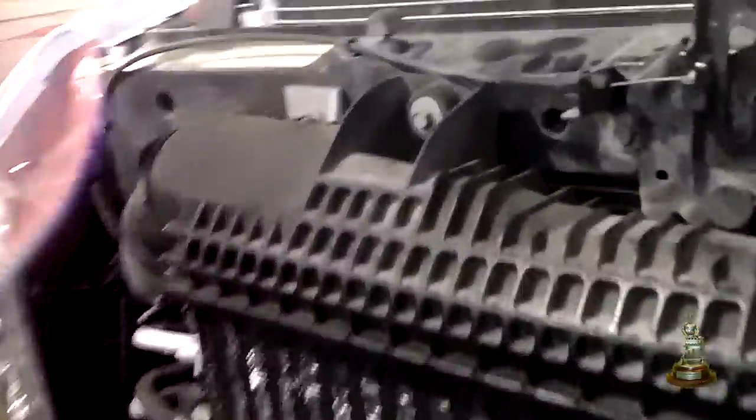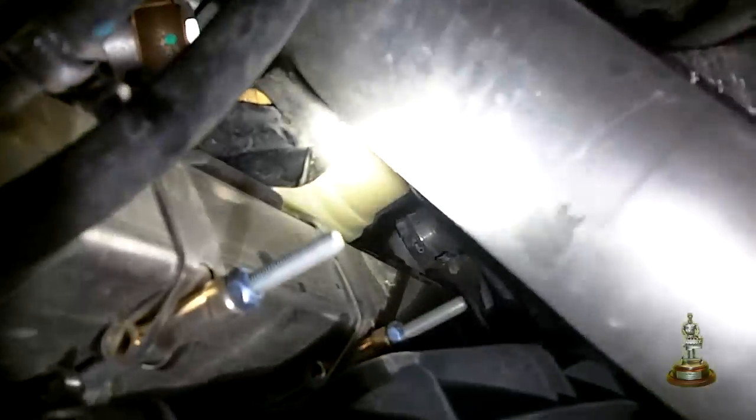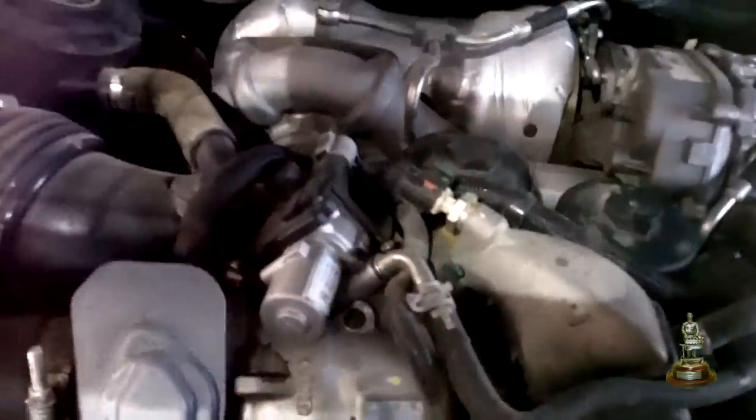This one has been leaking for a while. Luckily I noticed this — we have rust residue of coolant leaking through the EGR temp B sensor, which means we have an EGR cooler leaking. This vehicle has already had the hose replaced with the revised model. It once had an oil cooler failure, as you can tell by the oil stain, so we're going to replace that with the updated model.